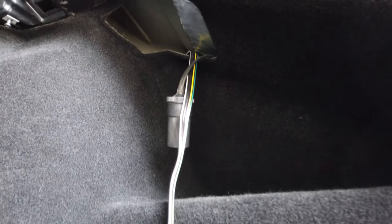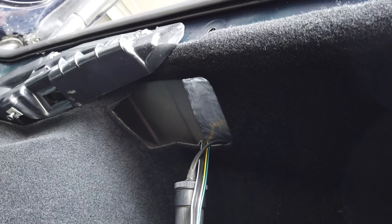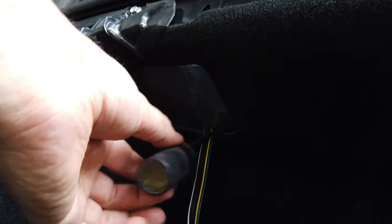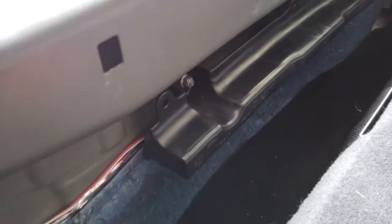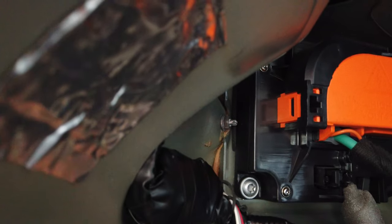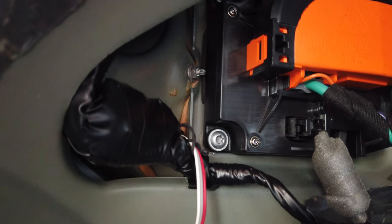I've got the carpet pushed back and all the wires tucked in. I still need to get some plastic parts back, but I wanted to show there's a hole up there already in the carpet — I didn't cut that. I think it's supposed to have a cap that was lost before we bought the car. This is where I have the auxiliary power port hanging out, which we're going to use to power our fans back here and potentially anything else we want to power. Then this is the trailer wire — with it coming out of that hole it can run along the side of the car and hang out to use with the trailer. I've got the power wire and blinker sensor for the left side coming along, running behind this padding to make sure they don't rattle, all the way across to this side. The blinker sensor for this side is wrapped with foam padding and electrician's tape, then tucked up there so it doesn't move around at all.